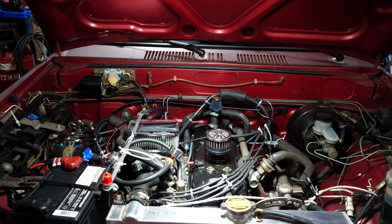The problem with torquing the head bolts on these engines is that, for one thing, they're about 40 years old and they've probably been taken apart maybe 2-3 times in that time and rebuilt. The head bolts have been reused, and now you can't get head bolts anymore for these. I have thought about using studs, but I haven't got that far yet. Maybe I will next time.